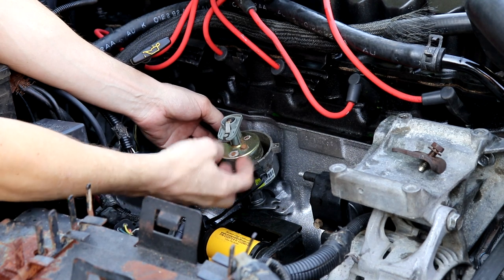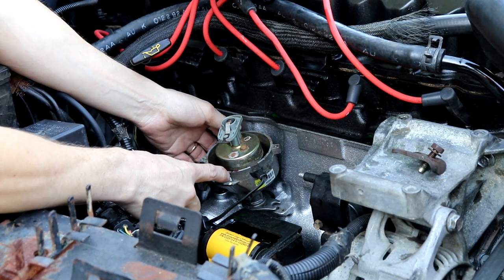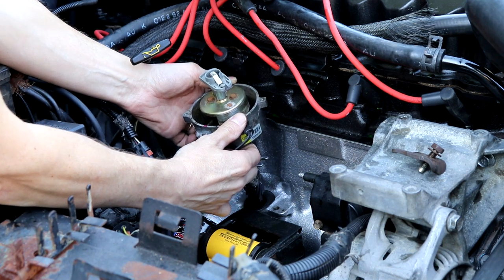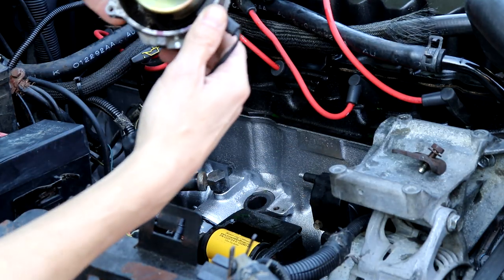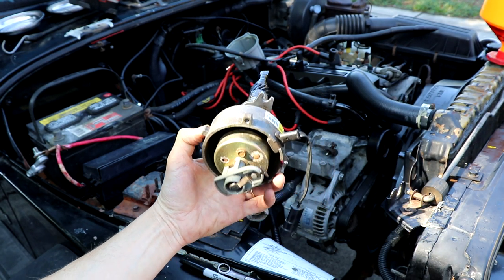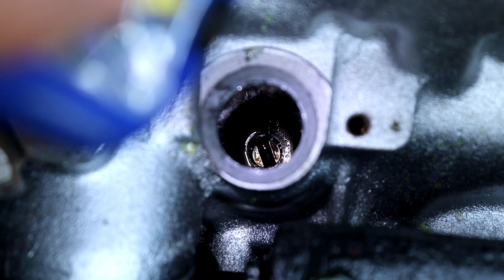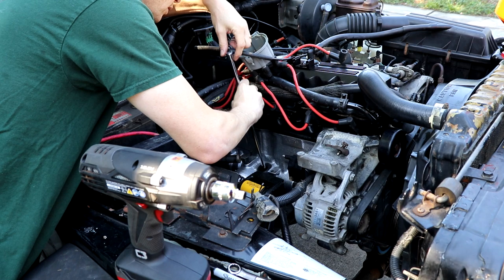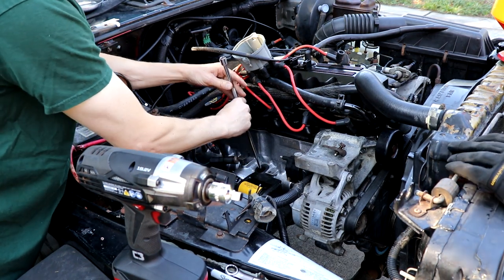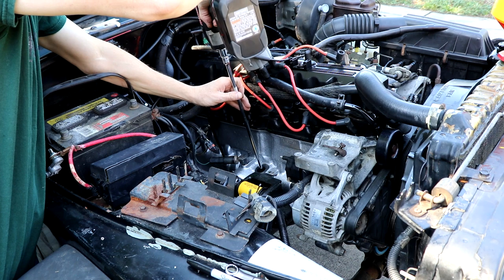As I pull the distributor out, you'll notice that the rotor will kind of back off a little bit, because it's on a helical gear — which is a twisted gear. So it's at about the 5 o'clock position right now. When I back it out, see how it backs off to like 3:30 or 4 o'clock. I'm going to leave it in that exact position so I can slide it right back in the same spot. Right here is where it mounts to the engine block, so it'll only go in one way. That is the oil pump right down there — we're going to put a flat blade on a drill and spin that clockwise. I've got the oil pump engaged here with the flat blade down on it, and I can put a drill on here and spin this. Doesn't have to be super fast.